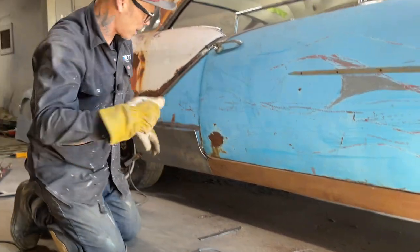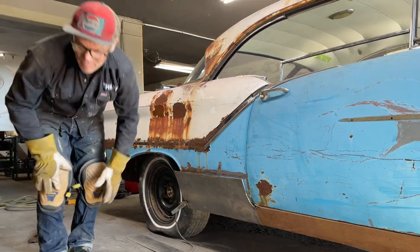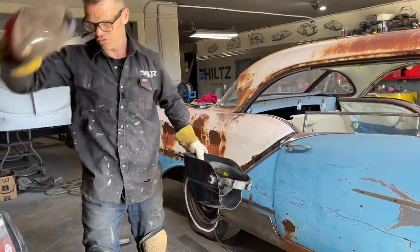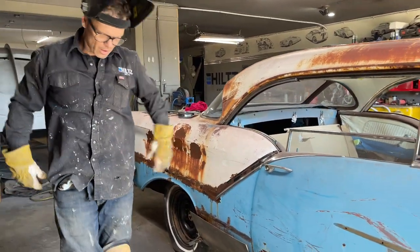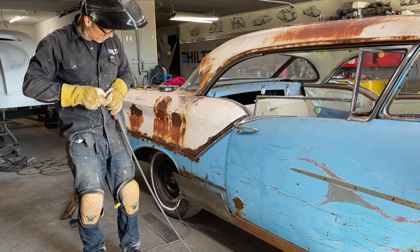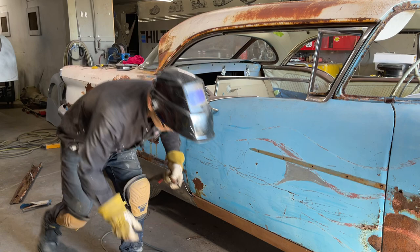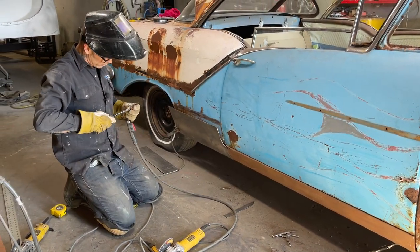If you'll take a look at the other side, you'll be able to tell that I did not hammer that hardly anywhere. I knocked it in, but if you take a look at the panels that I put on the other side, I did not hammer them all up with hammer marks. They are not all crooked. I did it so you're able to come in and apply some filler on it and be done in a hurry. And that's basically what you're going for.